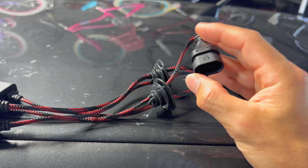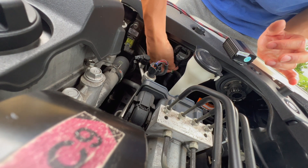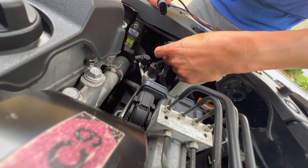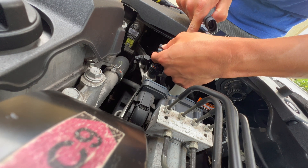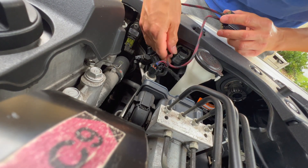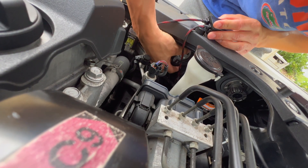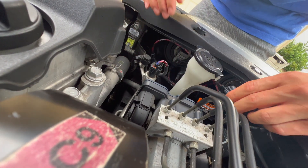You just have to pay attention to the polarity on these — this thing has a positive and a negative. Down here you can see where the high beam and the DRL are. You just unplug the existing connector, plug in the new one, and make sure you have the polarity correct. On Toyotas, the white with the black stripes on either side is ground, so just make sure that's on the ground. Then the other end goes into the light bulb — slide it right in, make sure it clips in and holds tightly, and mount the canceler on the side.